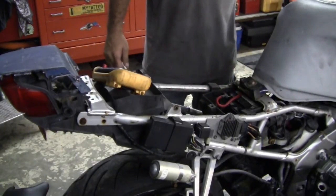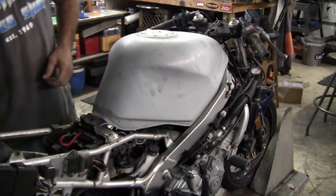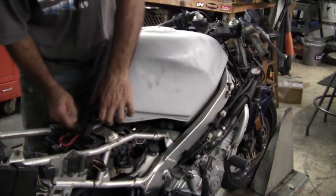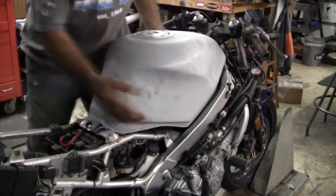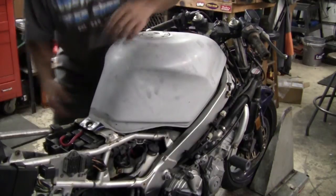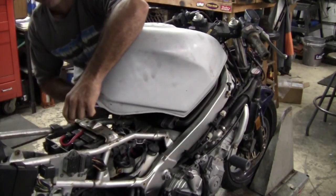So we'll go for the gas. This gas is gone so we gotta get that out of here. Take the tank off. Yeah, these bolts are like hand tight, so if someone's been in here messing around — you know, if it starts or at least turns over you're like, man, maybe they got it. Another thing: the petcock — a lot of times they're just bad. You got a full tank of shitty gas. Don't try to put fresh gas on top of this. This is like turkey time and it's all through the whole system. If you're prepared to have gas dump all over you, even if you have it off, because this petcock is frozen solid.